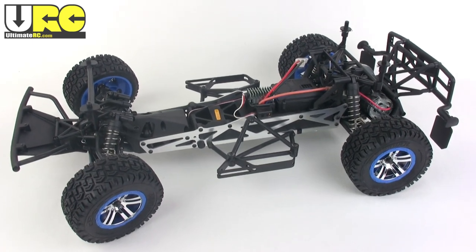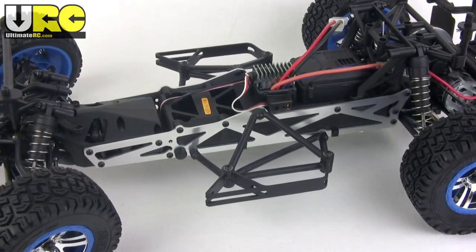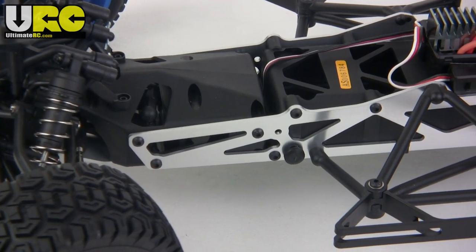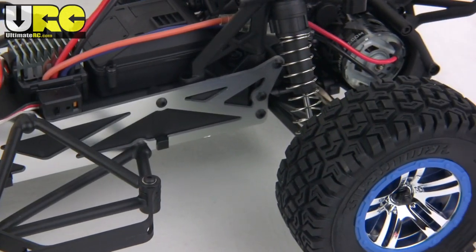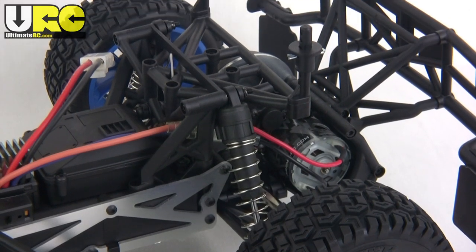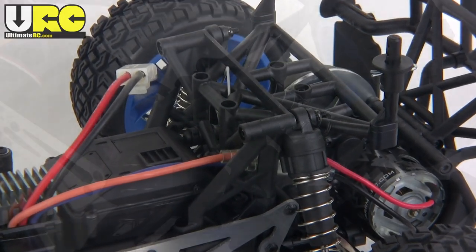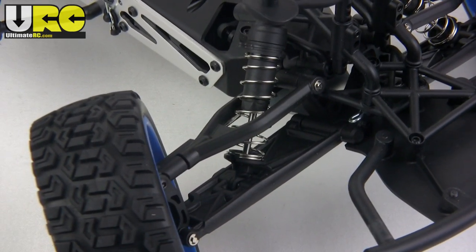Here you'll find a design that's consistent across all of the Arma two-wheel drive vehicles so far. It uses twin vertical plates, the design that was popularized by the HPI Savage. These aluminum plates provide basically the backbone for the entire chassis. They make these chassis in two lengths: shorter for the small buggy and stadium truck, and longer for the monster truck and this. Shock towers and body mounts use an interesting tube frame sort of construction.